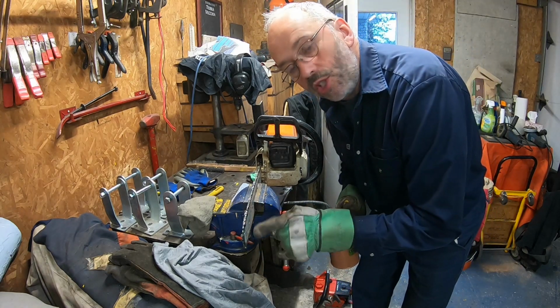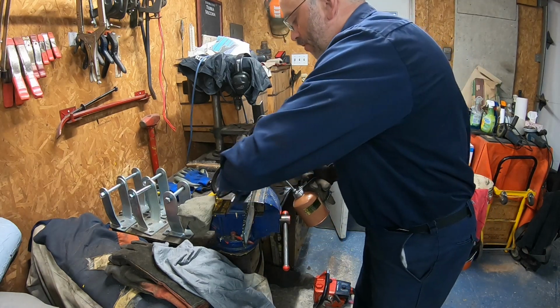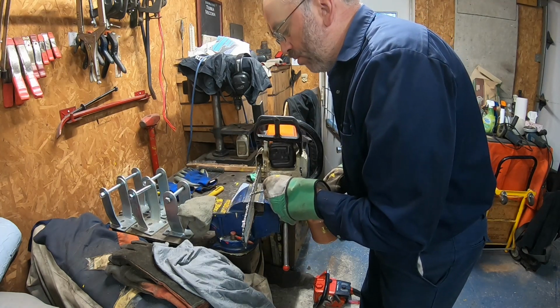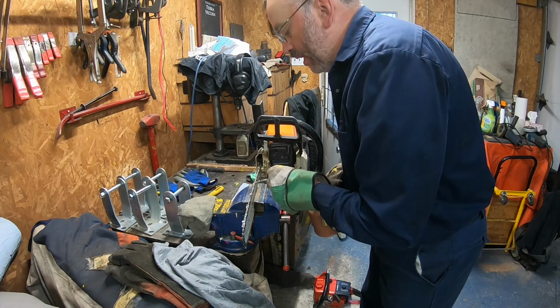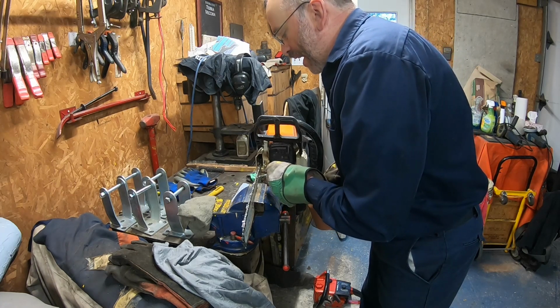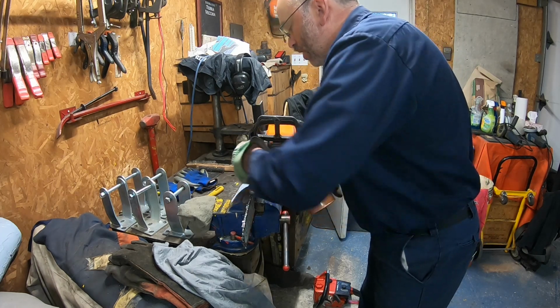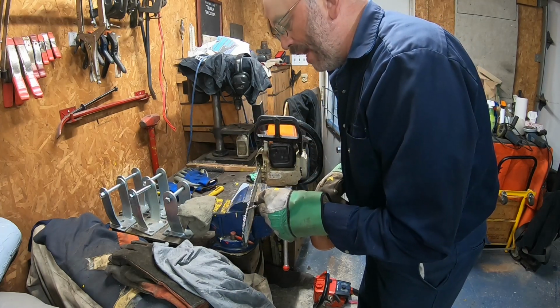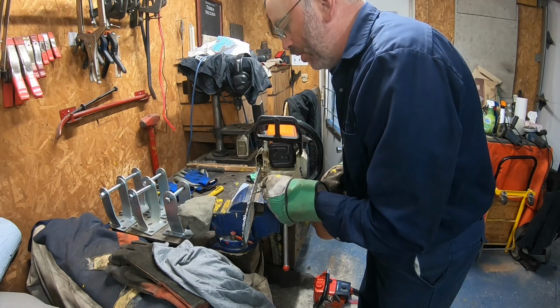These pockets on the chain are very, very fragile, so they're tough, but you want to make sure they're well lubricated. The bar chain is made for that, but adding that at the beginning of the day, just a little bit of extra oil won't kill anything. Well, it will help lubricate.